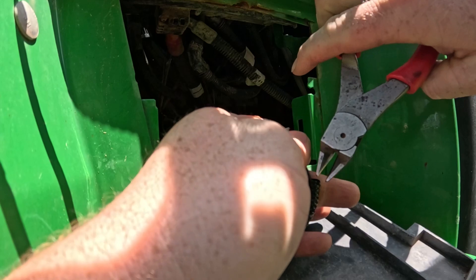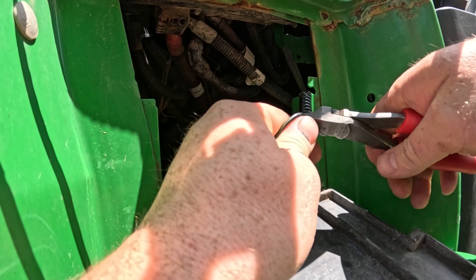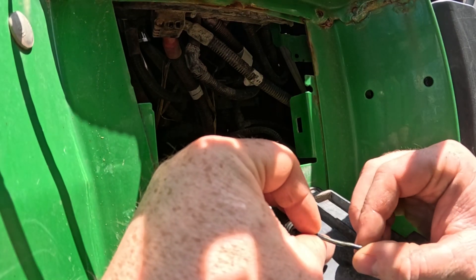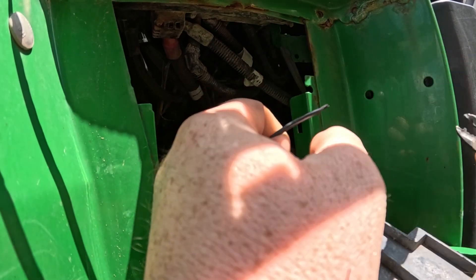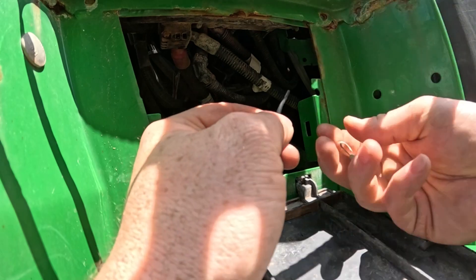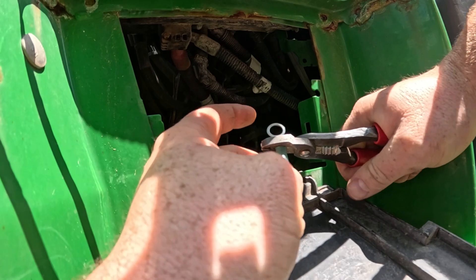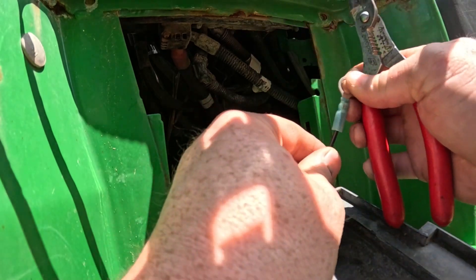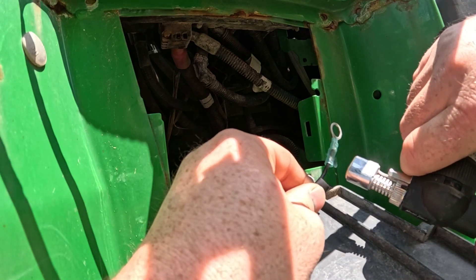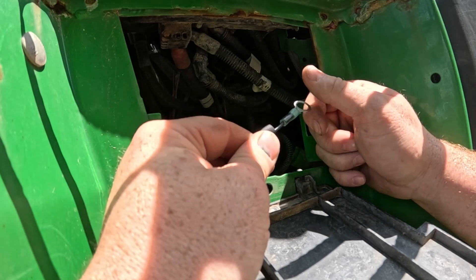There's plenty of extra wire, so I'm going to strip this back just a little bit. That is wire number 0330A. We'll strip the wire, and we've got the new eyelet here. Got a good crimp on that. We'll go ahead and shrink that portion of it, let that cool just a little bit, then we'll slide this second piece of heat shrink over there just for extra protection.